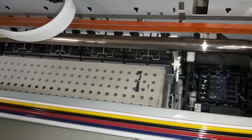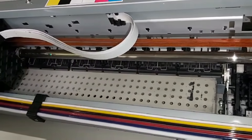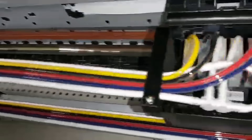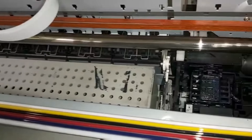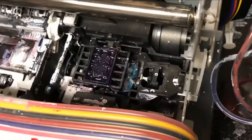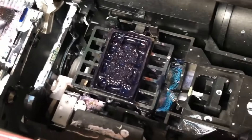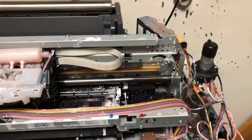— spits out like a fountain and explodes everywhere. Now we start seeing the ink stains; the platform where the ink just lays everywhere is starting to create a mess. The reason for this is your capping station is partially clogged.